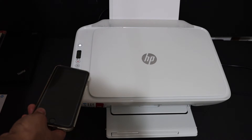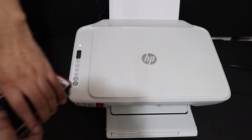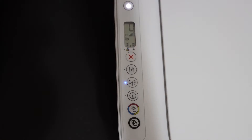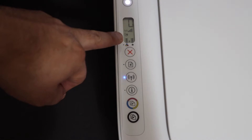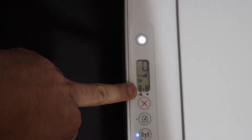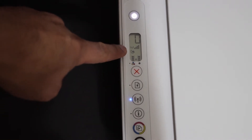I'm going to show you how to add this printer in your iPhone. The first step is to switch on the printer and go to the display panel. Once your printer is ready, we need to activate the Wi-Fi Direct. Wi-Fi Direct is a small icon you can see on the screen, just above the tri-color ink cartridge icon. To activate it, just press the wireless button once — if you see it there, it's already activated.